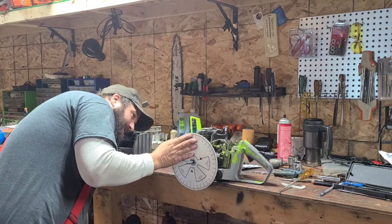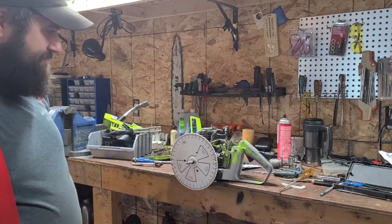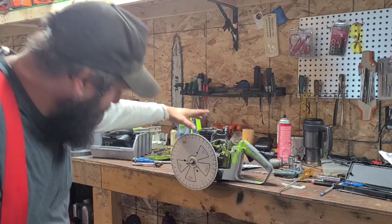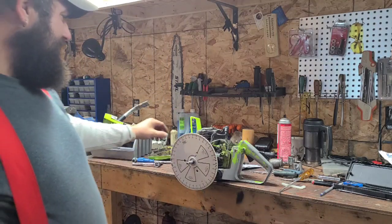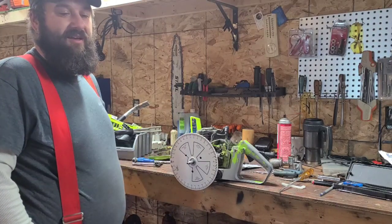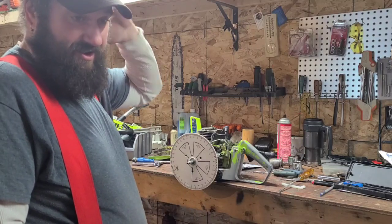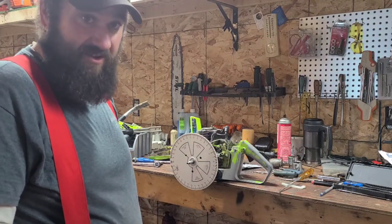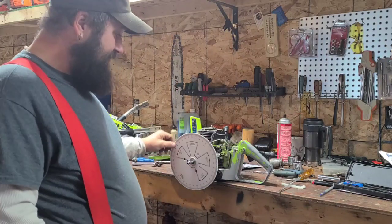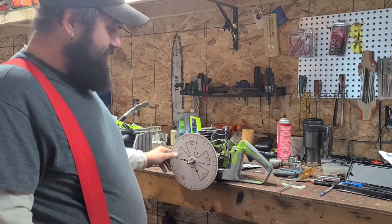104. I will spin it around and I will watch it close. It closes right there. We're at, what is it, 104 it closes at. Again, that's your exhaust duration. How many degrees between it opening and closing is your duration? You don't want your durations too long. You don't want your exhaust open too long. As a general rule, some saws will like that. You don't want your exhaust open too long, and you don't want your intake open too long.